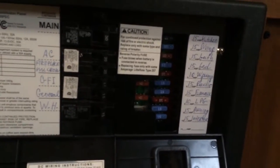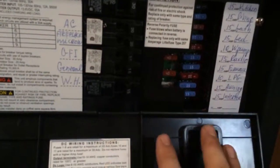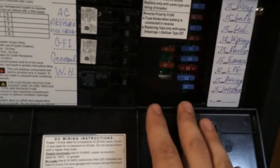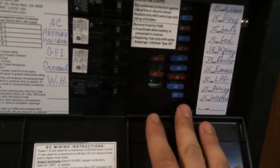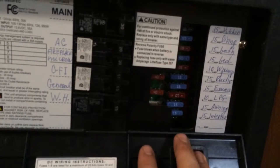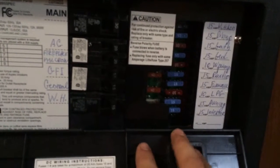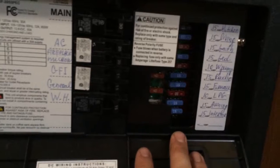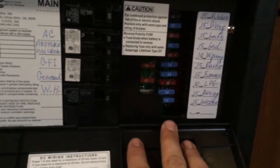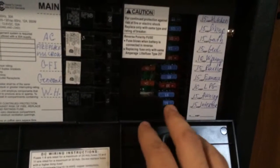I don't want to get too detailed — this is just supposed to be a quick video. Remember, there are always 12 volt fuses on a lot of travel trailers inside the converter. On a lot of Class A motorhomes, it's going to be on the driver's side front left compartment, but also on the interior. The first place I always look is the driver's front left compartment — especially on Monacos. Anybody that owns a Monaco knows all about that.